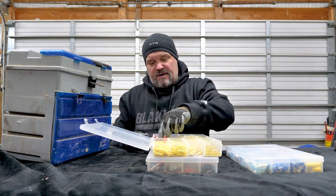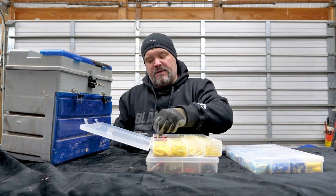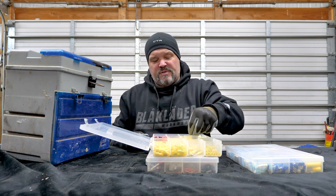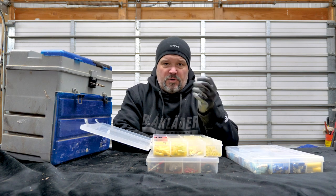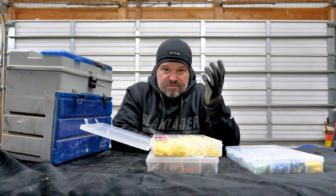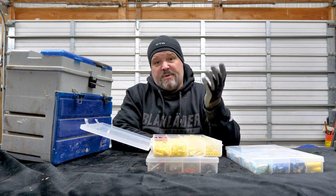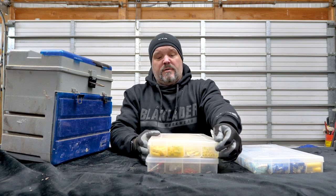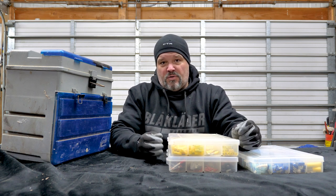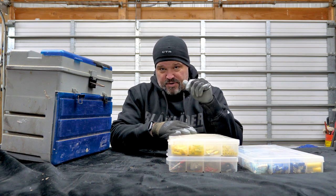I do have some car audio stuff — black and red for positive and negative. Certain connections in low voltage require you to observe polarity, and other times, like lighting, not so much. I always try to run polarity the same when doing my low voltage stuff. I actually tested it once — mixed everything up and it didn't matter since it's low voltage. But if you're a true hardcore wire guy, you'll run all polarity the same way, which I do. On low voltage wires there are usually indicators through markings, letters, numbers, or stripes.